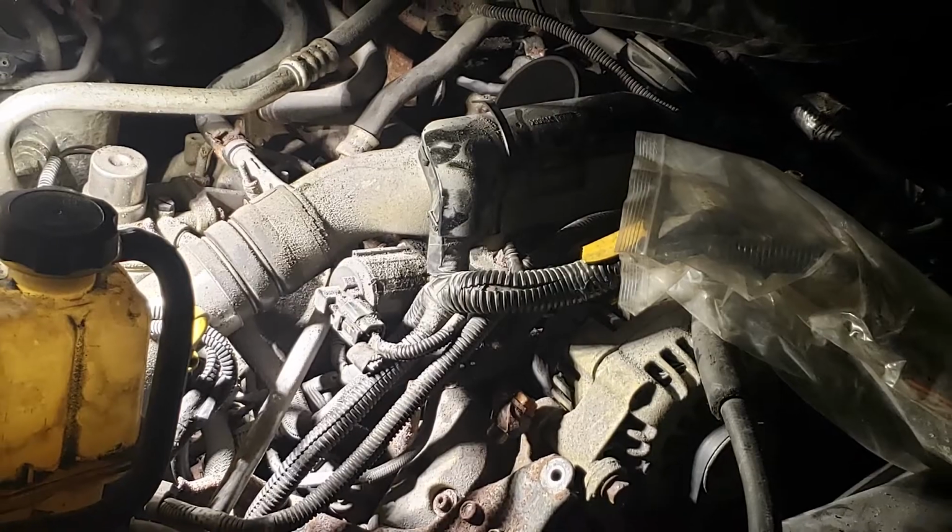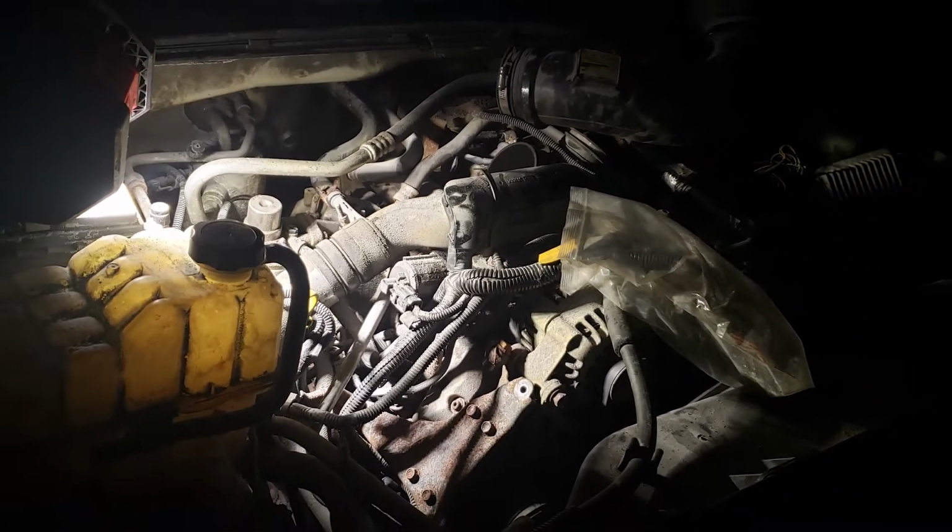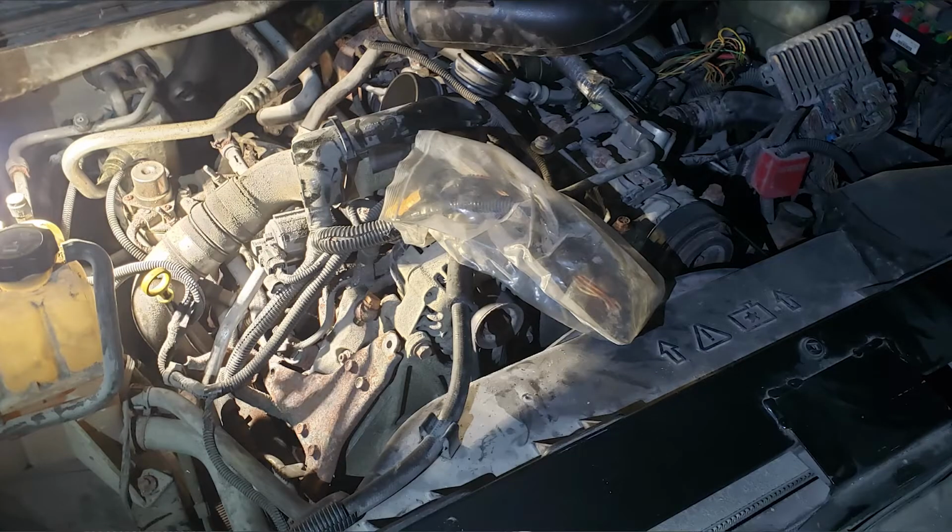So I got to the salt mine early, and I took that fuel injector control module that I had received back in the mail that was checked out. I installed it, and I just wanted to verify I was dealing with the same situation just by turning the key on. I didn't even try and crank it. Turning the key on, I was setting the U0105. This time around, I was setting the U0106, and the U0073 popped up again. So I was like, well, this isn't good, but let me try and crank on it anyhow. I just want to see if anything changed.